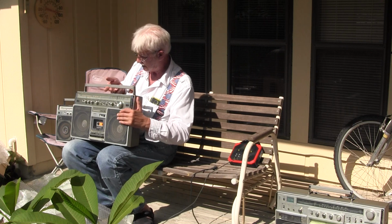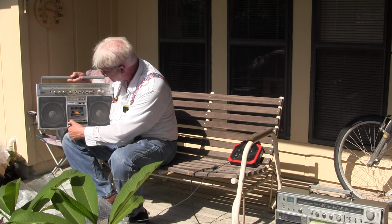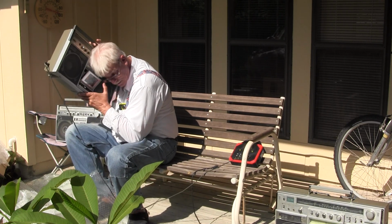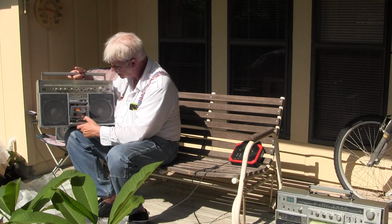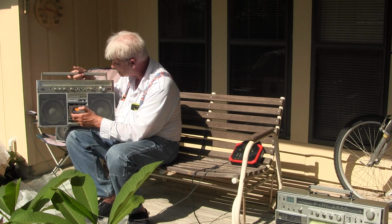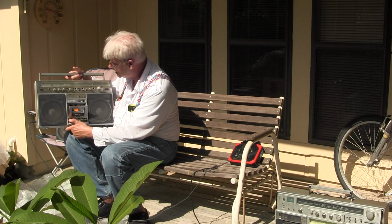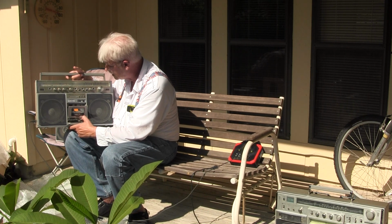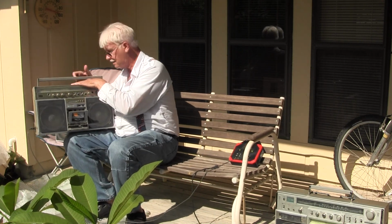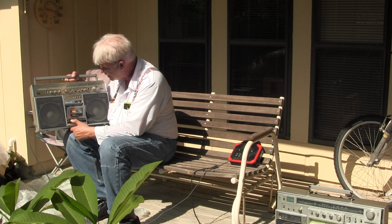Turn that off. Let's check out the tape deck here. Let's see. So hit play. Well, this is hit eject. I think I can hear the motor running. There we go. We got audio, but the capstan is not turning. Okay. And let me turn this off. Here. Okay. Stop.